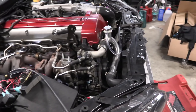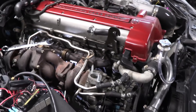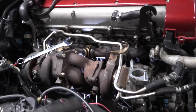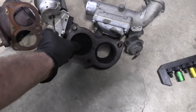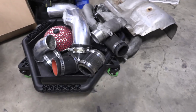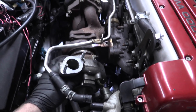So much time has gone by. I figured I should give an update, although I'm not able to show as much progress as I would have wanted to. It's been like seven hours today that I've been working on this thing and I've really failed to get it all broken down. I've got all the bolts off the top there of the manifold. I've got a bunch off the underneath. A lot of things were blocking from the underneath, so I've been disassembling it coming from the bottom. The most recent thing is I just got the part off that does the sequential — that's the actuator for the sequential — and that's the blocked port right there, which changes the exhaust gas over. Getting closer, hopefully just a few more hours.